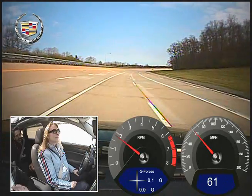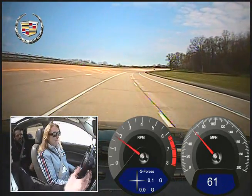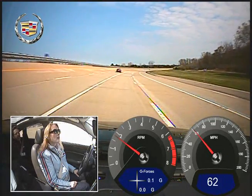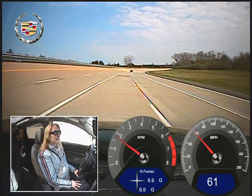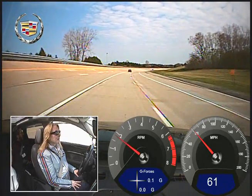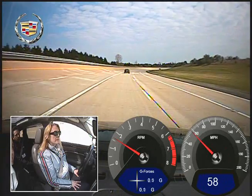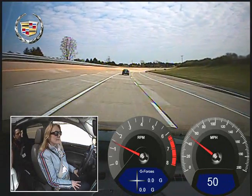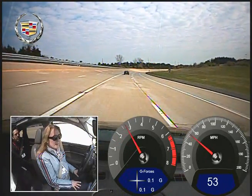So we're going to do a few maneuvers. WD is going to get ahead of us, pass us, and pull in front of us, and you're going to see the vehicle head icon light up. Then he's going to slow down to 50 — you don't need to do anything. It will automatically slow down to 50 and maintain a two-second gap behind him. He's a few seconds away, so you're going to get closer automatically, and when you're at about two seconds away it'll start to back off to his speed. WD, go ahead and pick up to 70 — so you're going to go back to your set speed of 61, and it'll speed back up as he goes away.